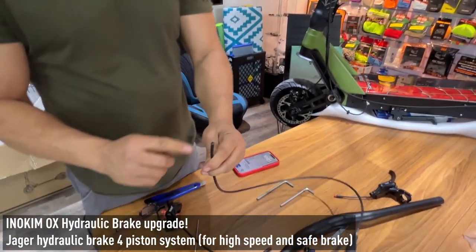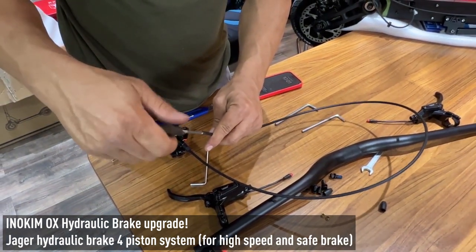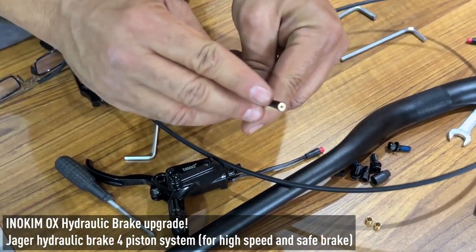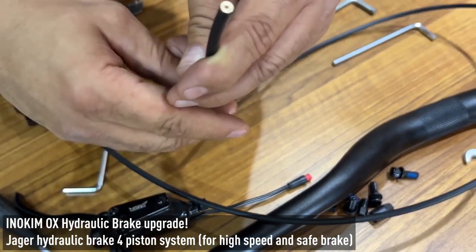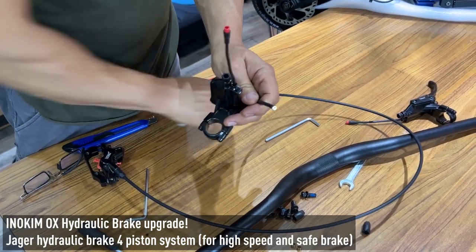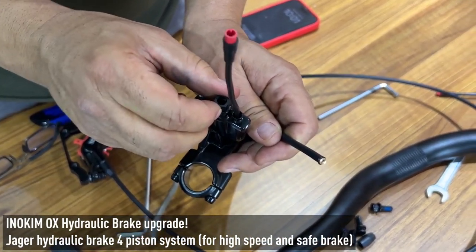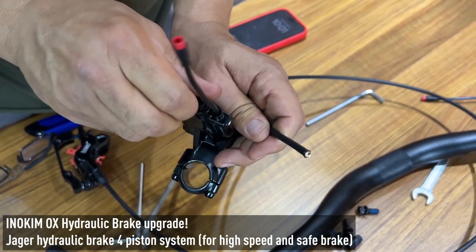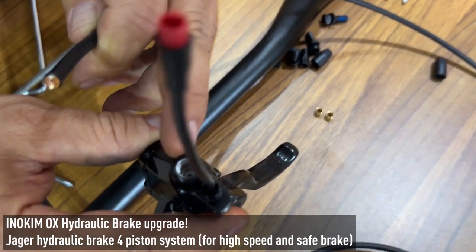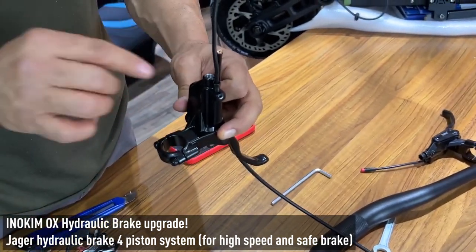After the pipe is in the upward position, I take the screwdriver and take out the screw. Now it's open. As you see here, there's a little bit of oil — so I keep it like this. I do the same with this one: take the Allen key and open this screw. Now as you see, you have oil here and oil here. You don't need to add anything. In this position, if the oil is not leaking, you don't need to add oil.